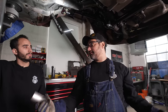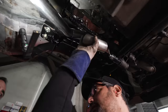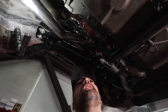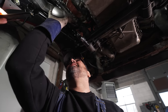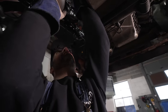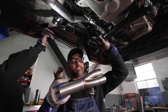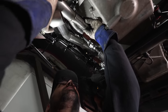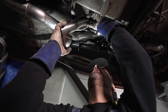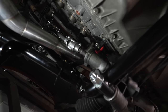Yeah, so the passenger side is always the easier side in a left-hand drive vehicle, or you know, any car, because the passenger doesn't steer the car. Driver's got the steering shaft that comes through. We got the smaller one from LMR, and it definitely helped with clearance, but it still has to be managed. We're gonna go three cylinders. Primaries are gonna come on the outside here of the steering shaft, and three will go on the inside. So it's really just about managing our space effectively. And believe it or not, having this directly under three cylinders is not as easy fitment-wise as having it behind. That way you have room for bends to get in here. So we're gonna push it back and angle it up a little bit just to get as much room for those bends as we can. You think, oh, stick them here, but that's not how it goes. It's gonna be behind it, so you have actual room to make those bends.